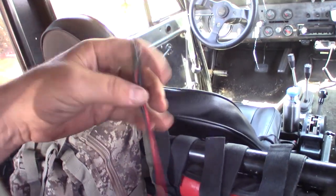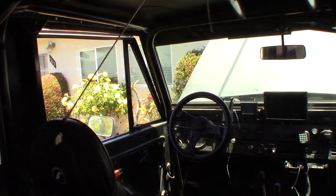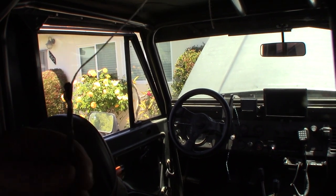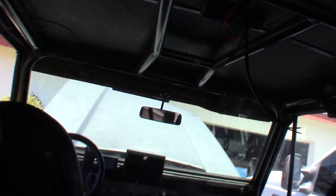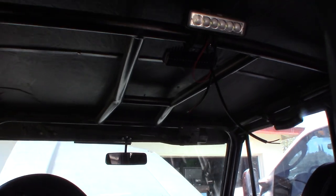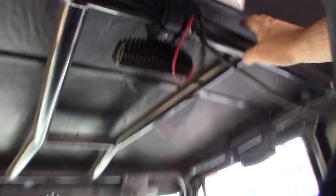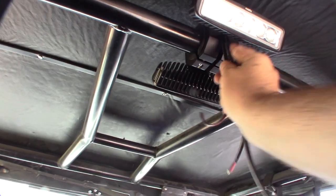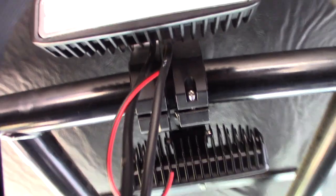I've got my wire taped on to my rope here. Having an inspection camera definitely saves a lot of time. I'm going to pull the fish tape back through, then pull this back through once the fish tape is done — 24 gauge wire. Got them mounted here. Got to do the wires, but I wanted them weatherproof too in case I ever take this top off, and because I live at the beach there's a lot of salty air here. I'll try to hide them and fish them back in that hole.